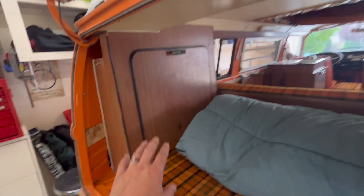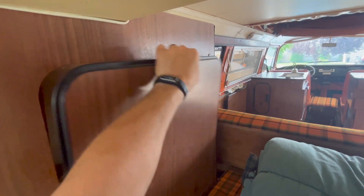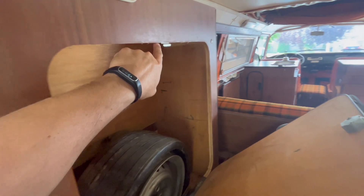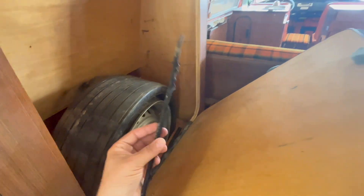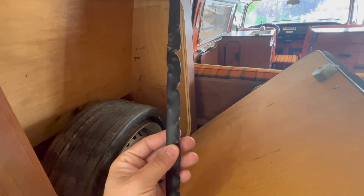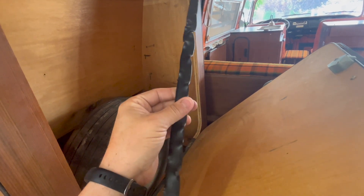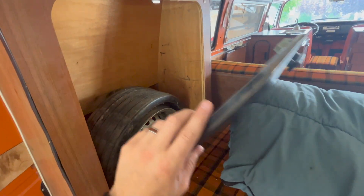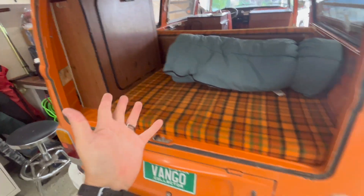I also did a few repair issues. This closet area was held up with coat hanger wire. The reason for that is there's a molding that gets pressed into this groove — with extreme heat it softens up, then cools and shrinks, creating bulges. Those bulges prevent the cabinet from closing. For now I've just removed them. There is a way to repair that which I can show you, but for now the cabinet works correctly.